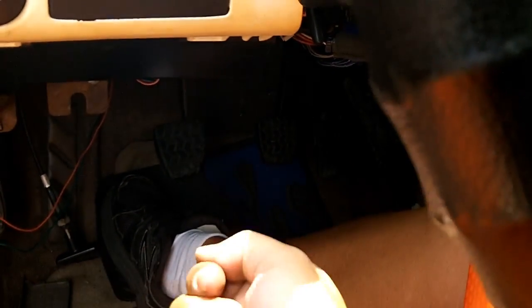You would need a scan tool, and you would hook that scan tool in with a plug, and then go through the menu system, and one of those options would be Reset ECU. And another, remember there are two, is Reset Keep Alive Memory. So you want to reset the ECU and the Keep Alive Memory if that's what you want to do. Because the Keep Alive Memory holds trouble codes that have happened over many driving cycles, some of them up to 80 driving cycles before it will set a code.